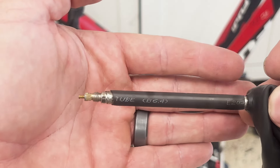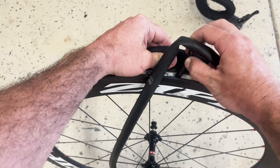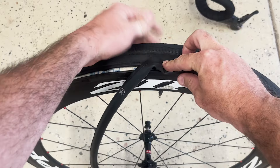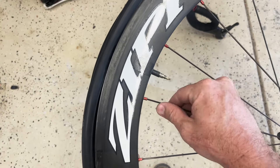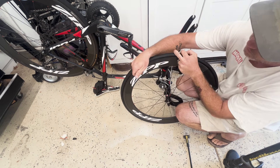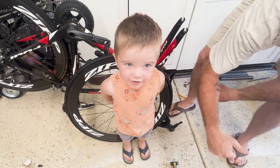So here's the trick. We're going to grab this quarter inch shrink tubing that's typically used on electrical conduit to keep the wires from grounding out. We're just going to cut the tube to size, making sure that the base of the shrink tubing is touching the bottom of the valve. Slide it on over and then heat it up — we're just going to shrink it down. Now you can see that the shrink tubing is all nice and sealed as close as it can to the valve.